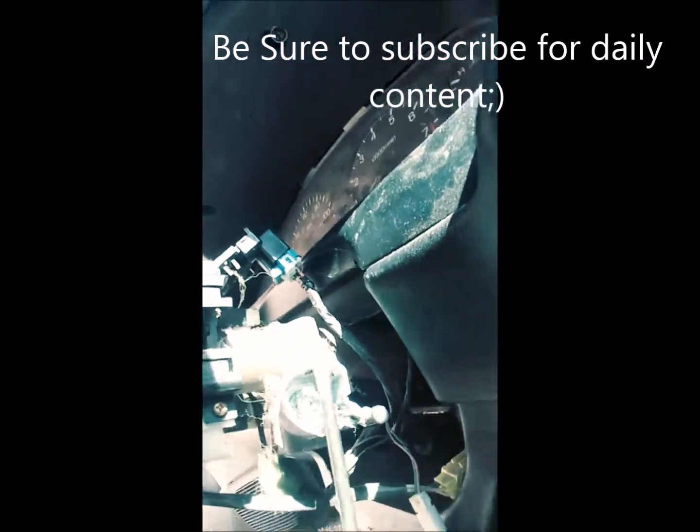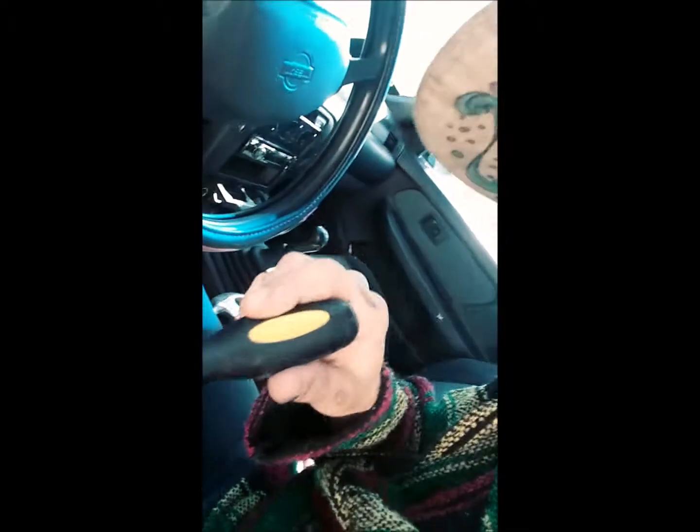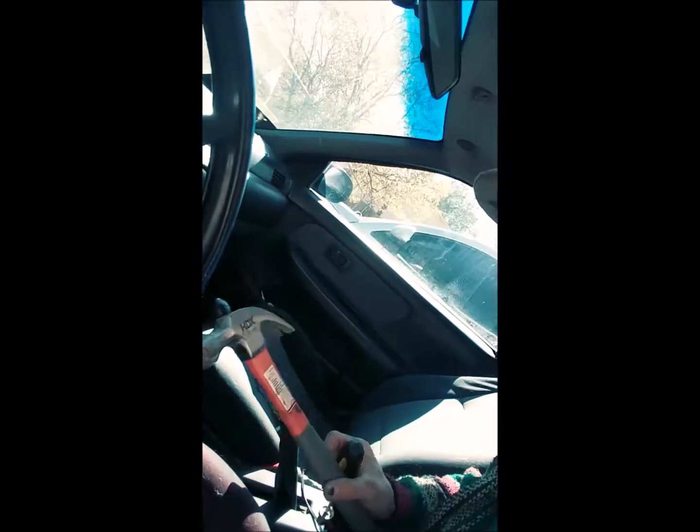You're just gonna take some pulling and tearing. Then there's gonna be a silver piece, and you're gonna need to pry that off with the screwdriver and expose the locking — whatever way you can get to it. Dig it in. You're ruining it, you're not gonna need it anymore. And what you're gonna need to find is this thing right here. Once you ram the screwdriver into the lock cylinder hole, you're gonna ram your key into that key slot. Once that silver cap is off, it's in little bitty chunks because we used the 16-ounce hammer — that's all you need.